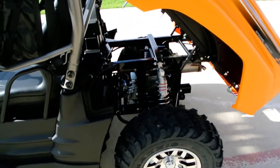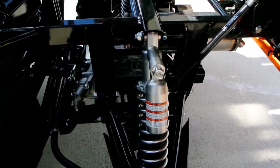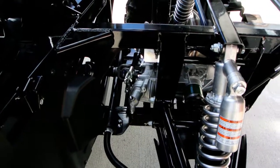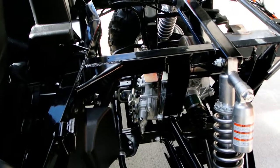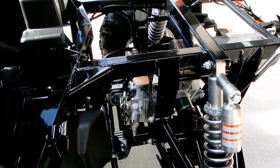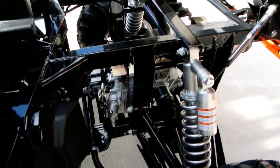These have comfortable seats. There's a tilt bed — your bed tilts just like that. Fully independent rear suspension, and again you have the aluminum body shocks with remote reservoirs and all the adjustments. Kawasaki's multi-disc wet rear brake is actually on the drive shaft, built into the rear end. It's fantastic — I absolutely love this feature. The rear brakes will probably never have to be replaced because it stays so clean. That brake rides in an oil bath, the same oil that the gears ride in.